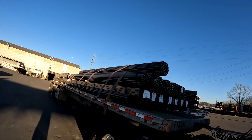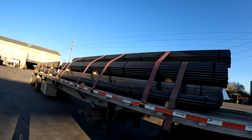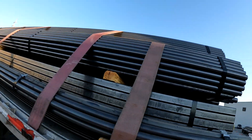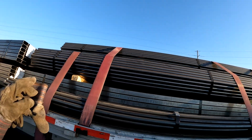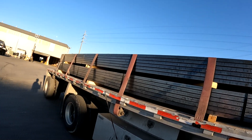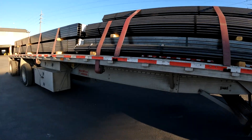Let me show you what I've got done so far. Here's my new trailer with the load. This front section is three layers, so I put a gut strap over the second layer there. Back here I've got gut straps and then four straps over the top. Back here it's just two layers, nice and square - I've got five straps over that, really tightened them down.